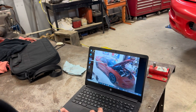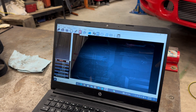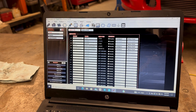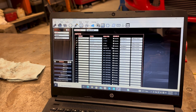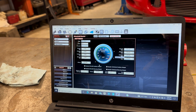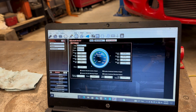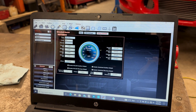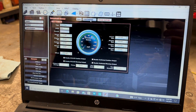We go into our Terminator X software and open the most recent file, James Tune 5. Then go to Inputs and Outputs, put in the driveshaft sensor. Since I'm running the CAN-IO module, mine will be CAN digital speed frequency. From there you can set your sensor minimums and maxes. For pulses to average — this Motion Raceworks sensor has 16 prongs on it, so we put pulses to 16. Gear ratio for my car is 4.11, so we've got that entered. Tire diameter is 28 inches.